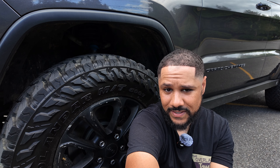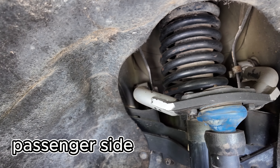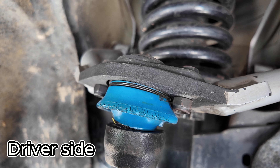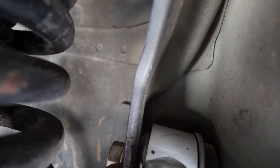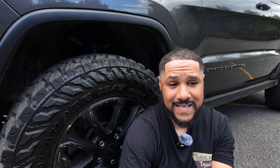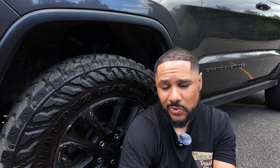So I got another set of ball joints. The passenger side was perfect, no problems. But the driver side is still squished, and now the boot is starting to crack around the edges. Not only that, the bushings on the actual arms themselves that connect to the Jeep — the inside bushings are completely disintegrated, they're gone. And that's less than two months after running these UCAs. I beat the Jeep up but not that bad — these are supposed to hold up.